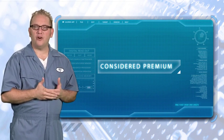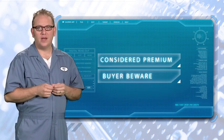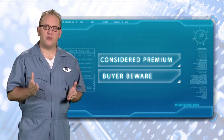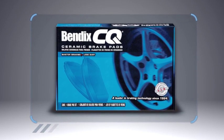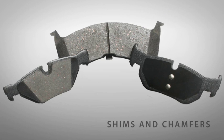However, it's not unheard of to see lower-priced ceramic pads. Just beware — some brands call their pads ceramic even if they have an extremely low ceramic content. Our engineers are committed to offering quality ceramic pads. Bendix CQ pads, for example, are our most widely used ceramic pads and feature 100% attached shims and chamfers to maximize noise reduction and premium ceramic formulation for quieter braking with less dust.